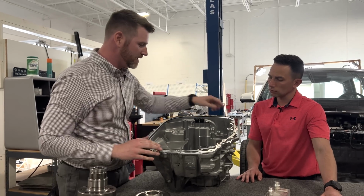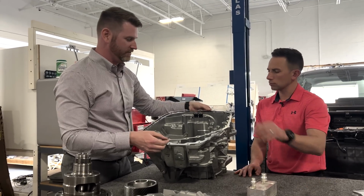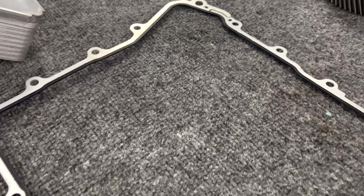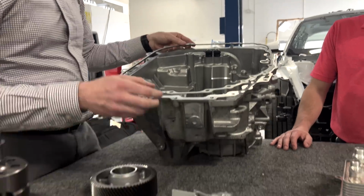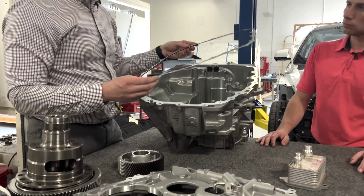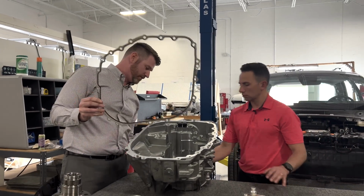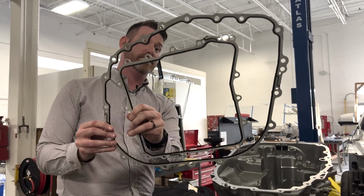And this is essentially, from what I've seen in some public literature, part of a family of vehicles, EDMs, from GM. One of the things that's interesting, and hopefully they are looking at this, obviously we talked about scrap rates and offal, but this is a stamped aluminum overmolded seal. So there's one on this side, and then there's one on the other side as well. Very similar, but I'm hoping that for some of the smaller ones, and then there's one also here from the inverter, maybe we can do some nesting and get some efficiency out of this.